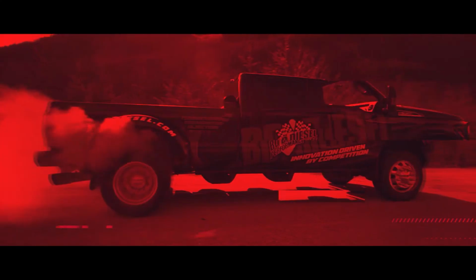Notoriously high exhaust temperatures from the 6.4 liter engine commonly cause its exhaust manifolds to fail. The excessive heat warps and cracks manifolds, which leads to engine performance loss and poor running. But do not sweat, we have a solution. Grab a cold drink and let me tell you how BD's 6.4 liter manifolds are built to take the heat.